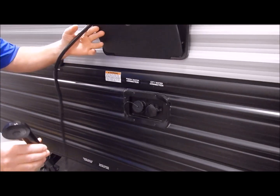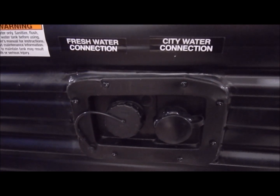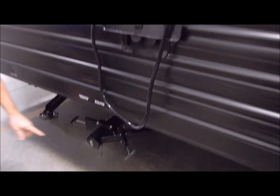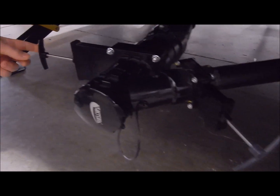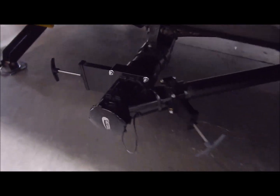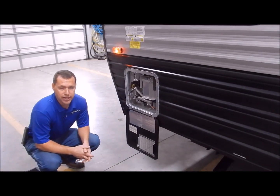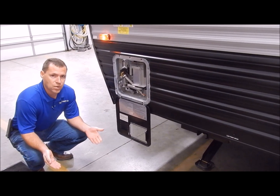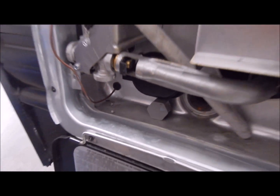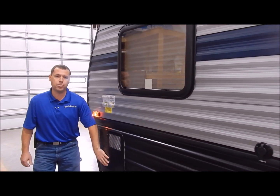Underneath the shower you have your city fill and your fresh water connection. Your fresh water connection is where you fill your fresh water holding tank through this port and turn on your water pump switch on the inside for dry camping. Your city water connection is where you connect your water hose at a campsite. At the dump station, you'll notice a gray handle and a black handle — the black handle is for your black tank (toilet) and the gray handle is for your shower and kitchen sink, all dumping out of one port. Lastly on the outside, you have your six-gallon gas-electric DSI (direct spark ignition) water heater. You can heat up to 10 gallons with gas or electric, and 16 gallons with a combination of both. There's an on/off switch on the lower left for the electric side; I'll show you the gas switch on the inside. Always remember to have water in the water heater before turning on the electric side so you don't burn up your heating element.